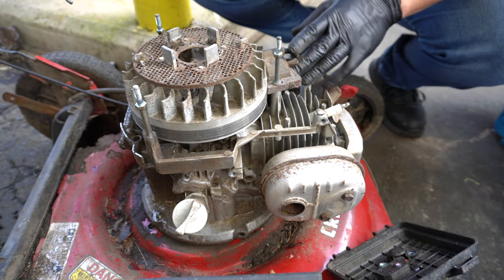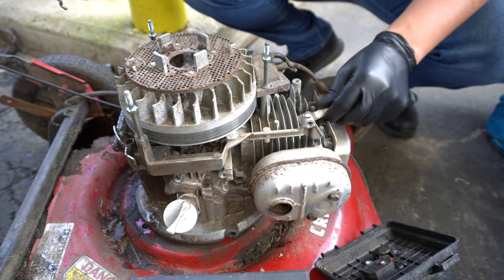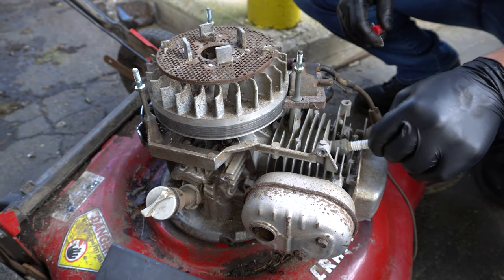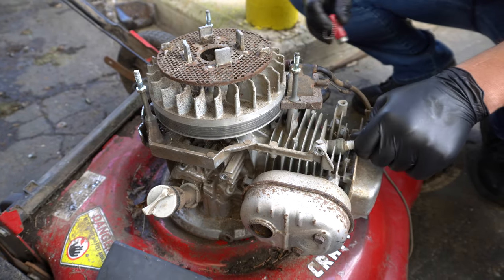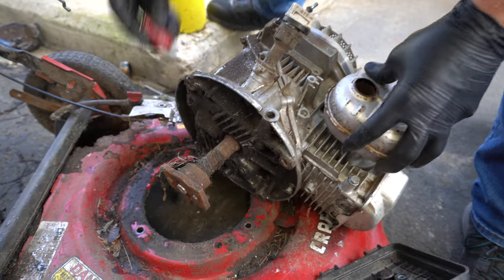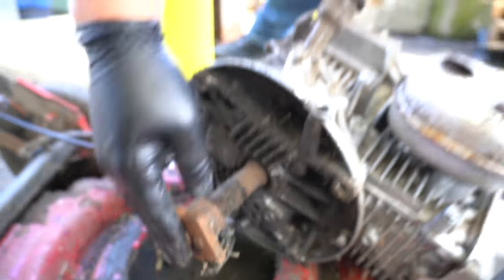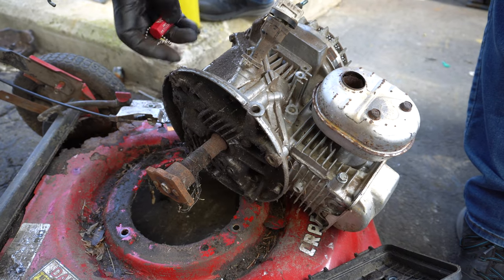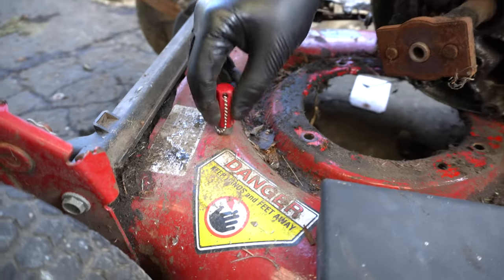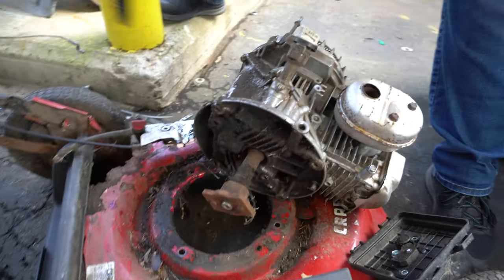Let's take that magnet and look at this engine real quick. This part is steel, but this piece right here is aluminum — the engine's aluminum. You have a spark plug. A spark plug is a great item that you can take out and sell to RR Cats. The more of these you have, there's little bits of platinum inside, so sometimes you can get a little money for those. The engine has been removed, and looking inside you can see the rotor, which would have the blades on it turning around. You've got to take those blades off to be able to get this out, especially if the entire thing is aluminum. Now once in a while this cage will be aluminum — this one is steel — but the cage is going to be something that makes you more money than the rest of the engine combined, and the rest of the lawnmower.